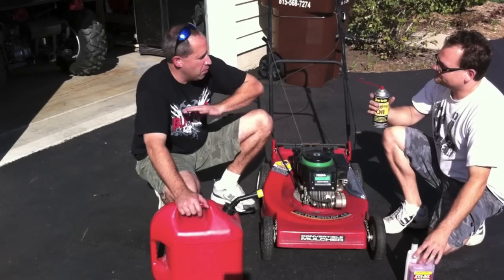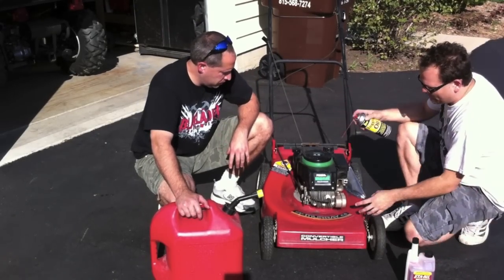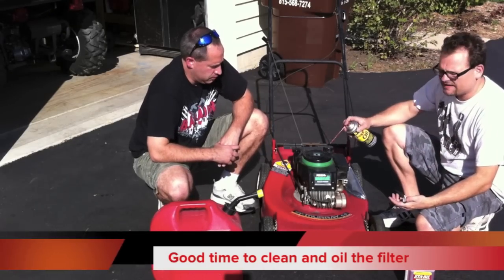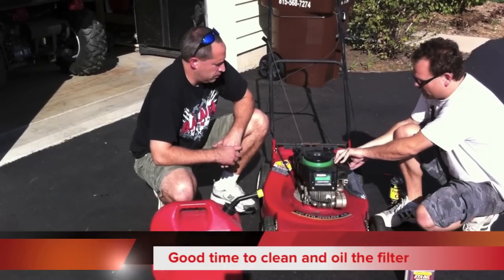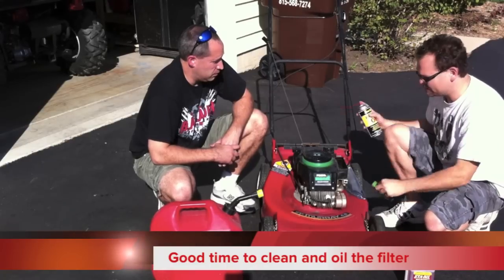So you do that last, once you are done mowing for the season, then you put it in there? Yeah, you put it in there. There are a couple of ways you can fog. When you are fogging you will see some smoke come out — that is good. A lot of times you will spray too much and it will just shut the engine down; that is okay too. So all you do is pull the air box, pull out the filter, and as it is running you spray it.